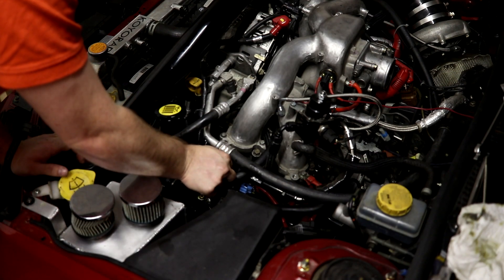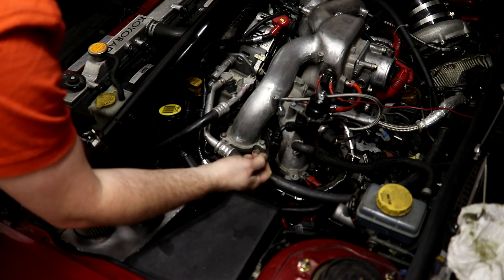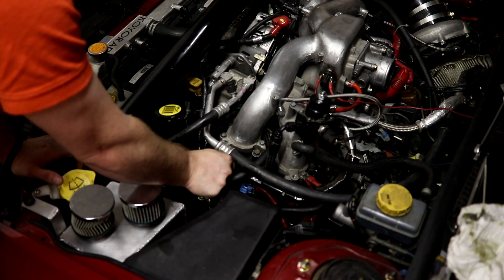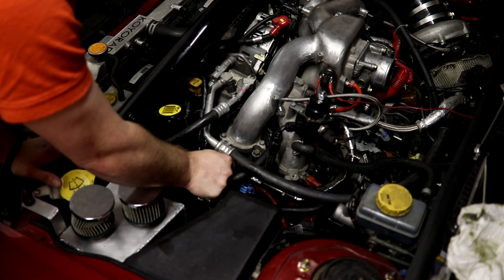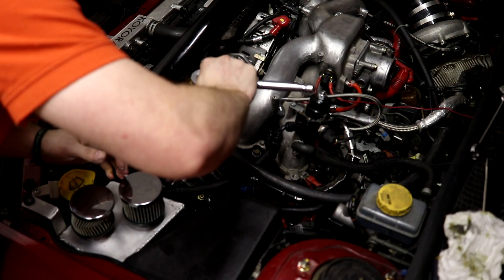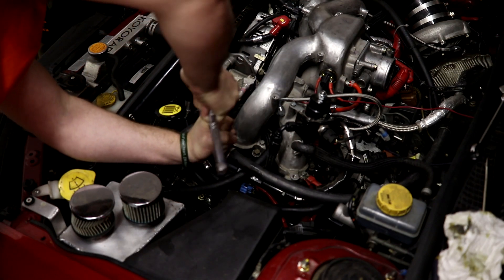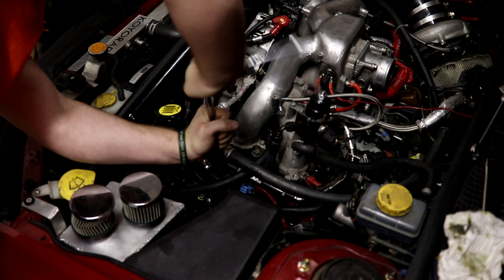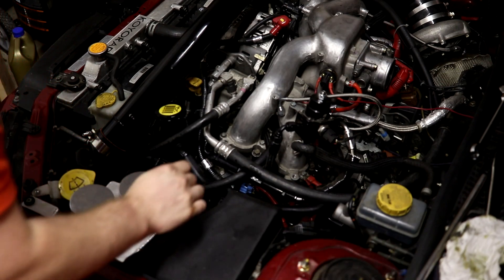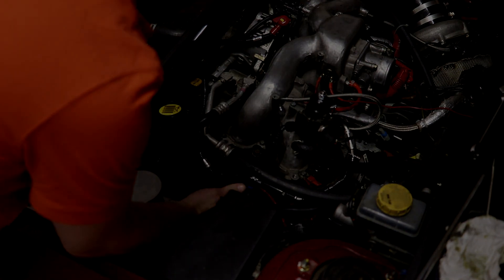Get it back into the hole — it just pops right in. If you're worried about contamination, like if you just rebuilt your motor, it's not a bad idea to get a magnet and check that port, because metal bits can get stuck in there. Pop these off and check the other side as well. Tighten that back down, that side is good to go. Put whatever you removed back on and continue to the other side.